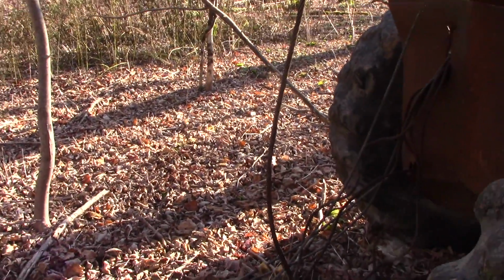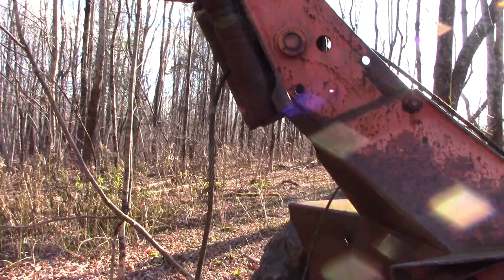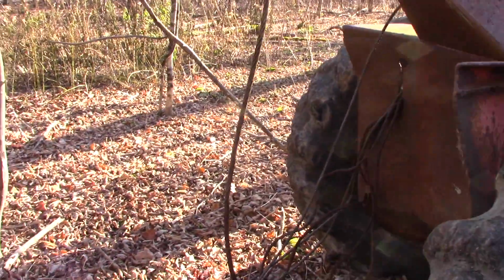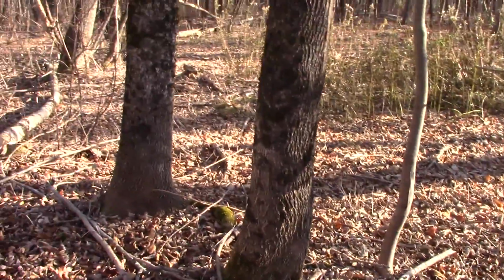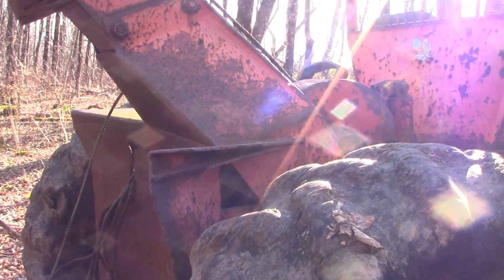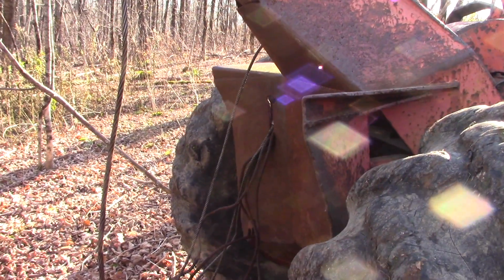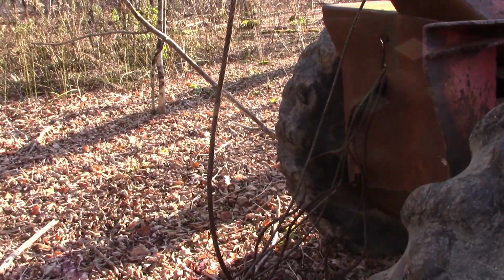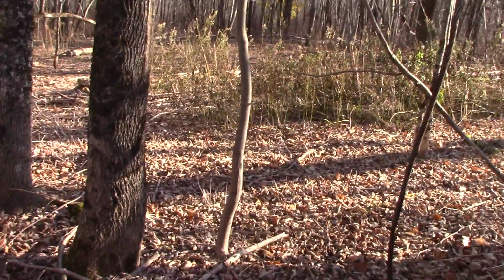The winch was working, now it's not. It'll release and then it'll stop. So just to get this hitch cleaned up, what I'll do is I'll put it in gear, let out a bunch of cable. But I'm gonna have to pull the winch off. I knew I was gonna have to. I was hoping I didn't, but I think we're gonna have to yank the winch and rebuild the clutch assembly.